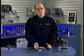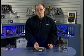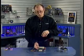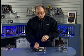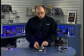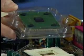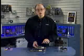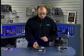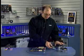Fracturing the die is the end of the processor, and manufacturers usually don't warranty that type of failure because it was caused by improper installation. To help ensure the heat sink is firmly seated and not pressed in on an angle, there are four pads — one in each corner of the processor. These are just an installation aid; they serve no purpose other than to help prevent rocking the heat sink back and forth.